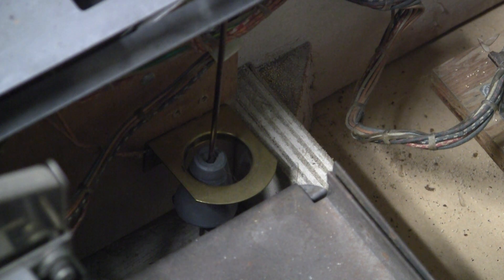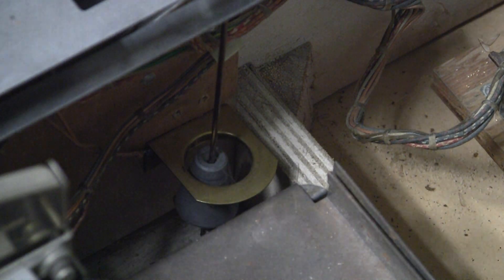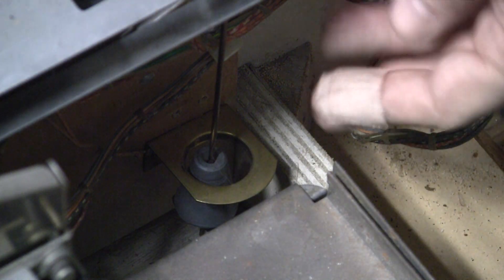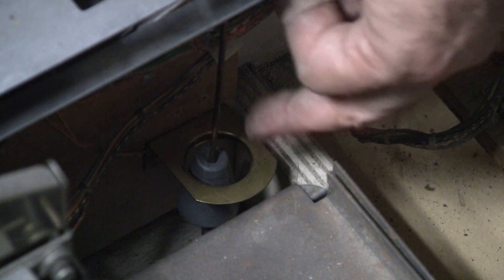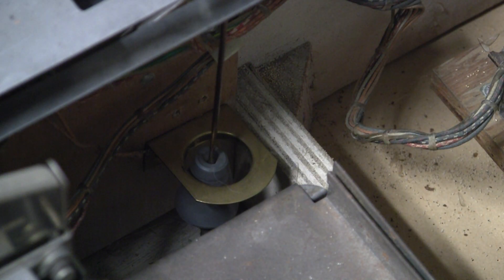If you're moving the machine around, you're supposed to move it a little bit because you want to nudge it. But if you move it too much, that's kind of cheating and it'll set the plumb bob off. Now this plumb bob is adjustable — you can raise or lower the lead weight so that there's more or less play. The higher up it is, the more sensitive it's going to be; the lower it is, the less sensitive.